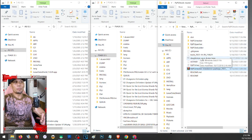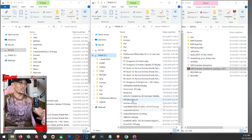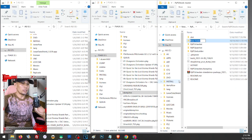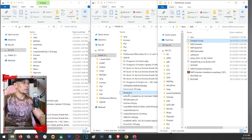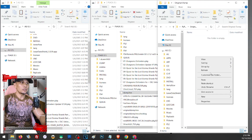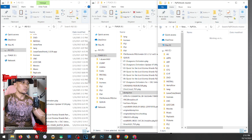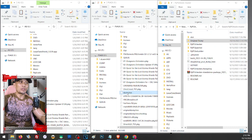Here you will have the BAT file. Go back to where we saved our original dump. In our case it is on this USB. Make sure you have the exact copy of your original dump file. I will create a folder named 'original'. From there, I will copy the dump and paste it inside our file checker folder. Then go back a folder and drag and drop the dump hex file into the BAT file.